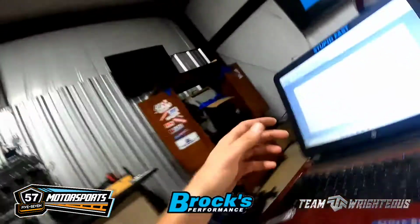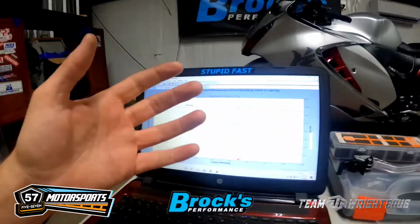Kawasaki 125 dirt bike on the dyno, and it was such a slow and long pull to get it up to peak or max RPM in 4th or 5th gear, whichever gear it was. It was a long way, so the horsepower curve was kind of dipping up and down and moving around, where generally when you make a fast pull like these bikes make, they're only making a pull for like 6 seconds instead of 20 seconds, so they'll be much smoother there. And that's all just the smoothing factor of dynos and how they work.